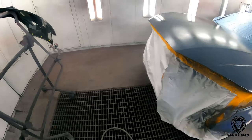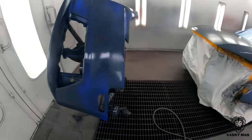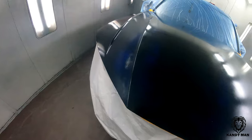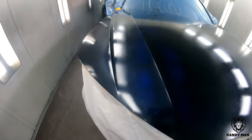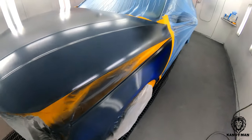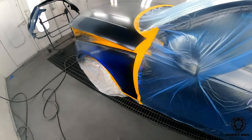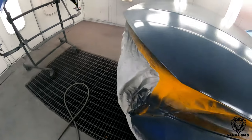And if you need it when you use it, go ahead and do what works for you. So we're gonna get into the base now. You can put your base right over the top of this while it's still wet, which sometimes helps you with the dry overspray. So go right into your base while this is still wet and you'll have less chance of that overspray blowing all around. It'll stick right onto that wet bed. So that is one other good feature of it. So let's do the base.